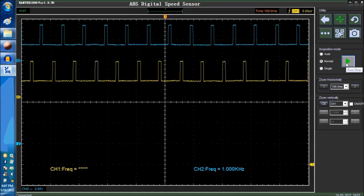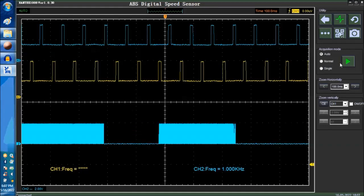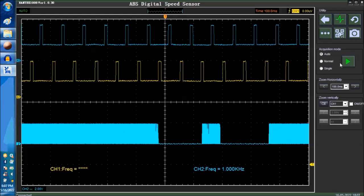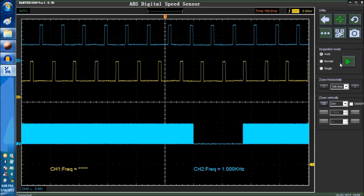And that's a recording that we created, okay? We can actually do single trigger. And you can't see anything because nothing is happening. We're not creating any glitches. And then we can do the original auto trigger. Auto trigger, in this particular case, is the best way because we don't know when the glitches are going to happen, okay? Because you're going out for road tests, and how are you going to trigger to the glitch, because you don't know when the glitch is going to happen.